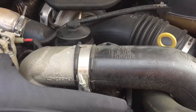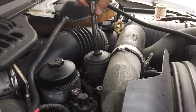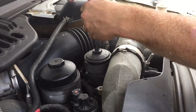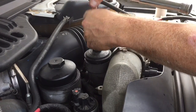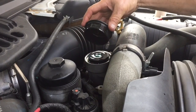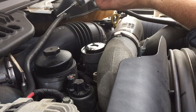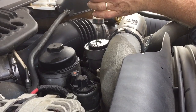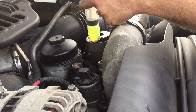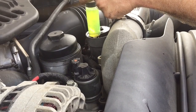Now my next filter is located on the top of the engine right here. To take that cap off, you either use a square drive like I'm using, or a 24-millimeter socket will also work. Now once I take the cap off, this whole cup is going to be filled with fuel. So what I'm going to do is take a turkey baster that I picked up at a local hardware store and just gently suck out some of the fuel — it'll make it a little bit easier so I won't have fuel all over my engine when I go to put the new filter in.